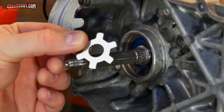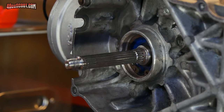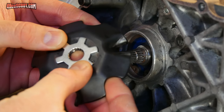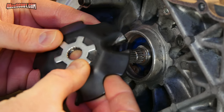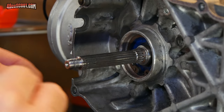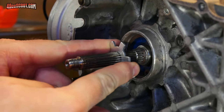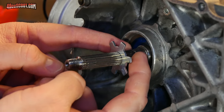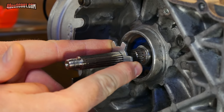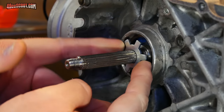take one of these keys that's normally in the fixed half of the variator, the drive face, and I'm thinking I can tack weld that to the back of the ramp plate just to lock it into place with the ramp plate. And that should allow me, if there is any twisting load, to put it behind there. The ramp plate would still sit over the scored area or very close to it anyway. It may move a little bit, but that should allow me to move the forces back behind that scored area